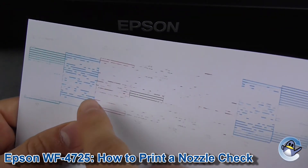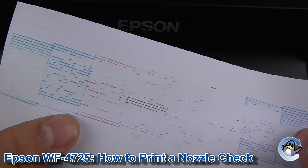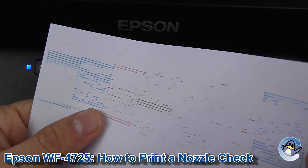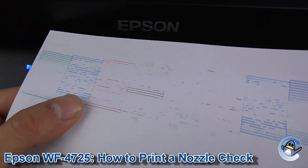What the printer has attempted to do here is break down all the different colours the printer can use — some multiple times — and give us an idea of where the print quality lies. This machine obviously has quite a severe issue, so I would recommend if you have anything even comparable to this to do some head cleaning to hopefully pull through the colours.